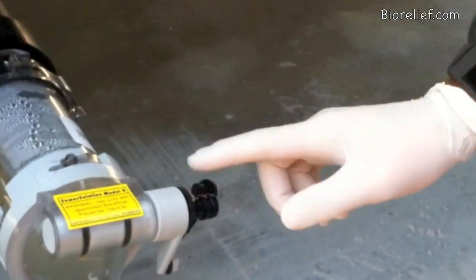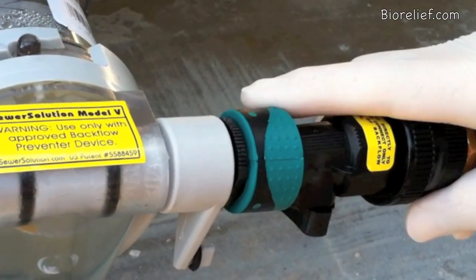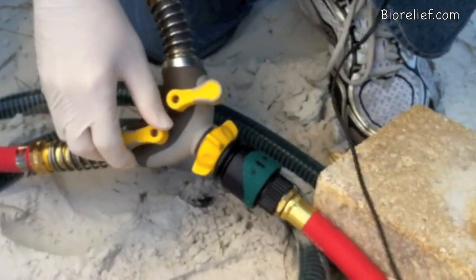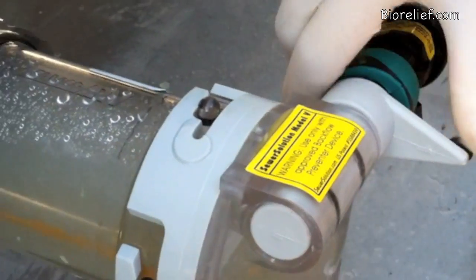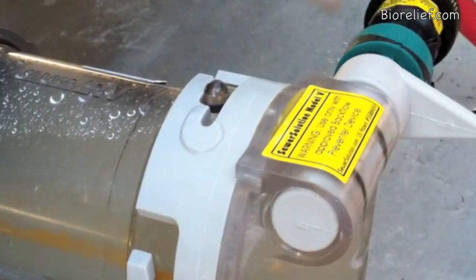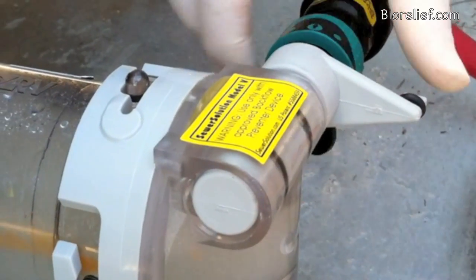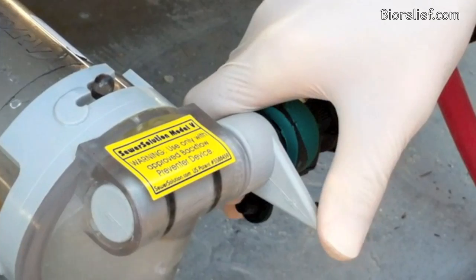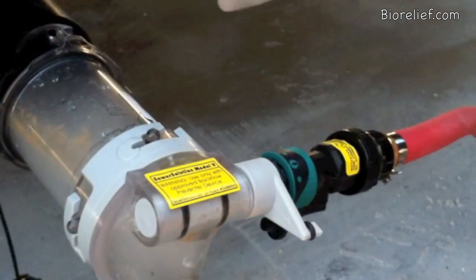What I'm going to do now is hook up the hose to the Sewer Solution because we're getting ready to dump. First thing is to take off this little cap — this is a backflow preventer, but the cap is on there just in case. We're going to go ahead and hook up the quick disconnect to that. You can see the quick disconnect is hooked up, and we want to run the water. So I'm going to turn on the water first, turn that on, and then turn it on right here. Now it's going the other direction — I'm going to turn it down the hose, and off it goes. The water is running down the hose, and you can see the Sewer Solution at work over here is pumping water. I have not emptied the gray water tank or the black water tank yet. So, I'm going to go ahead and release the black water.